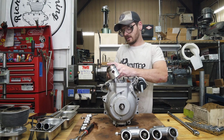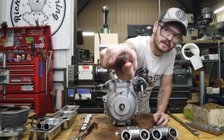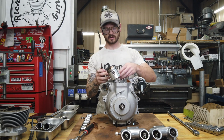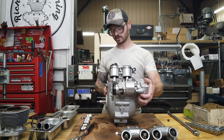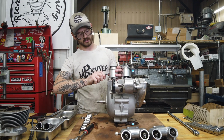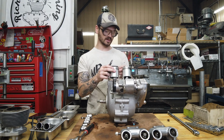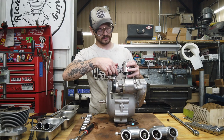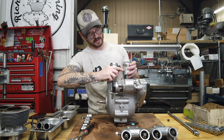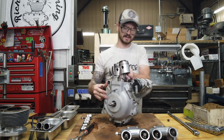Be very careful. Now, I call these G clips because they're kind of shaped like a G. I don't know if you can see those, but I really like those. Never had one spit or anything like that, so as far as I know, they're reliable, and they're so much easier to service. They're easier to get in. A standard clip, just the bare ones that have the razor sharp edges, are so hard to get out, which is a good thing because then you know they're not going to just fall out on their own, but they're so hard to deal with when you're just trying to do a service, or even putting them in. I shoot them across the shop all the time. Those are the type that have the wear safety glasses note with them.